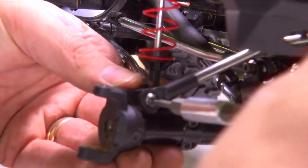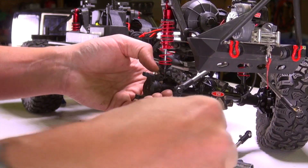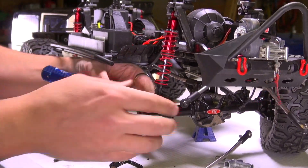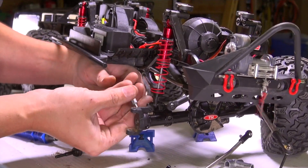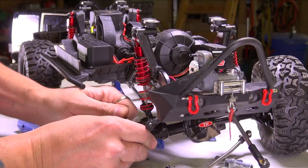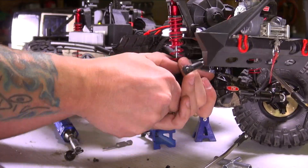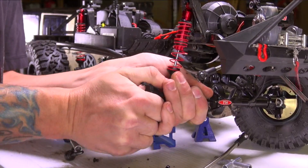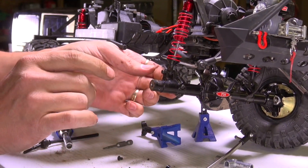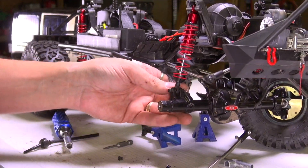This side of the axle has a panhard bar — a panhard basically is an axle stabilizer. There are two screws on the C-hub, they're very small. I'm going to use some Loctite on the new aluminum ones. One thing I noticed on the other side was the clocking of the preset C-hub — there's only one way for it to go on there. I found it was almost like it was clocked too much. This has a flat spot right here and a flat spot on the other side, so there's only one way to slide these C-hubs on, which means non-clockable — no adjustment.